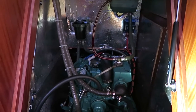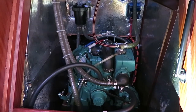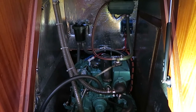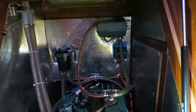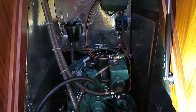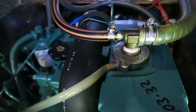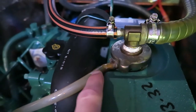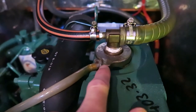Last summer I solved the problem with my coolant leak, but I've had an eye on the system for some time. I think it is still losing a bit of coolant, but now I have found out where the coolant is running. As you can see, we have the cap, and there's coolant entering a little into this hose here.